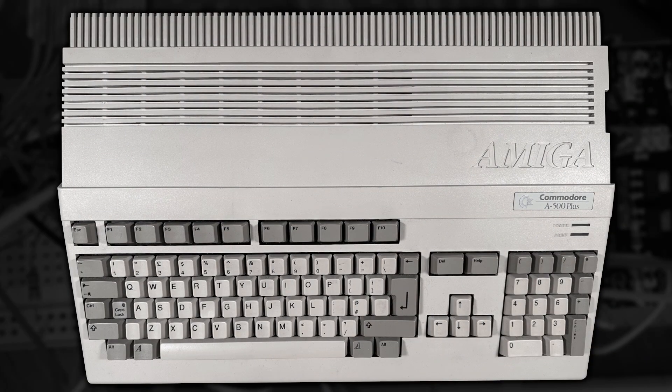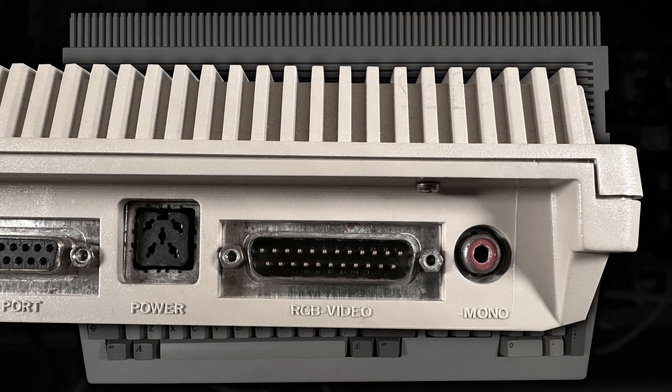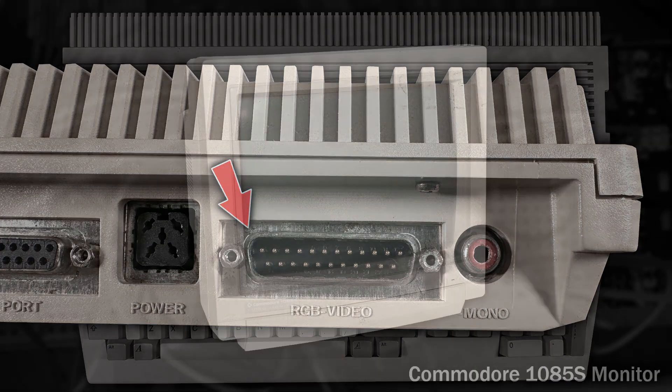Here I have an Amiga 500 Plus — yes, a working one. Now back in the day there were several ways you could connect your Amiga up to a screen, and each method produced a different quality of picture. The first and most basic: you could use the composite video connector on the back of the A500, however this was monochrome only, so no colour. The second was using the RGB port next to it, and there were several options here. Obviously you could purchase a monitor that would plug directly into this, but that was an additional cost and not everybody could afford that. This however would be the best quality.